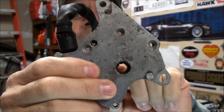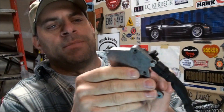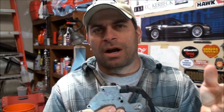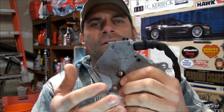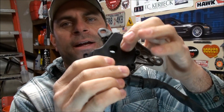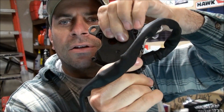I noticed a little bit of corrosion where the pin from the transmission came through — I thought maybe moisture got in there. This is held on with two small torx bolts to the transmission and they're a real bear to get to. I removed an engine mount — both mounts actually — there's a strut there, it's a real pain. But once you get that stuff out of the way the two bolts come out, the whole unit slides off, and it's that simple. This black case on the back is held on with two rivets.